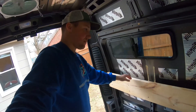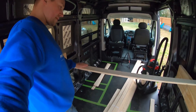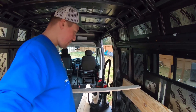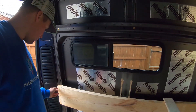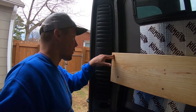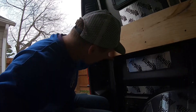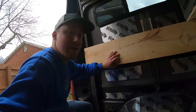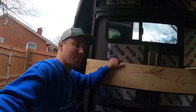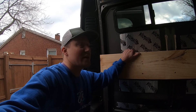Alright, bed frame's in. The plan will be to put two-by-fours across the top — so that's how high our bed's going to sit. The main reason is so we can fit bikes underneath. With the bed frame being a little bit wobbly, this is a hollow piece, so I might shoot a hole through this corner and put another plus nut in there so it won't be twisting at all. But otherwise everything lines up perfectly, exactly the way I was hoping. Squaring it up with the frame of the vehicle — I think we're doing a pretty decent job. Let's shoot that hole in on both sides, then go ahead and frame out the rest of the members that we've already done.